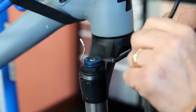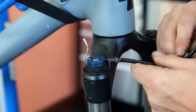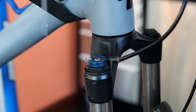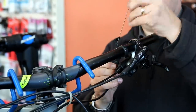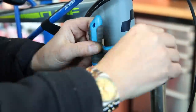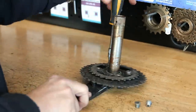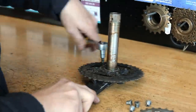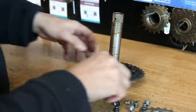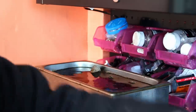This front cable - you can see how that outer has absolutely corroded away on the ends. Actually both ends were corroded, and a little piece in the center, so we're going to replace this cable entirely. The lockout shifter actuator wasn't working at all, so we're putting a new cable on. We'll just take the top off to clean that up through the ultrasonic cleaner and make sure there's no debris stuck underneath. If it still didn't actuate I would have gone deeper into the forks, but we didn't need to - you can sometimes overthink things and rack up the price unnecessarily.